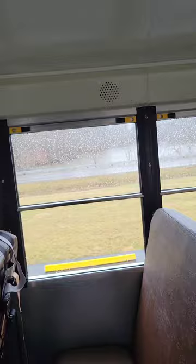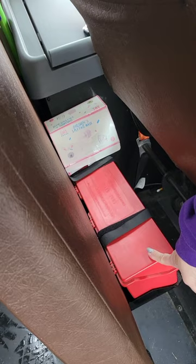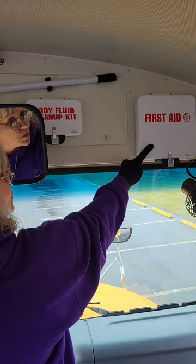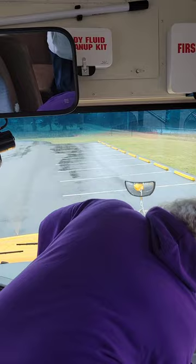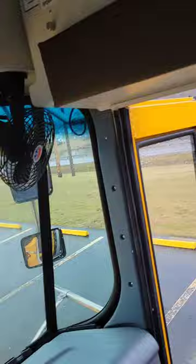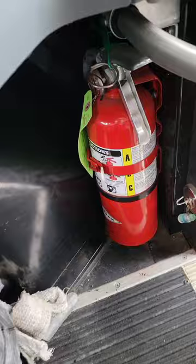My road kit right here behind my driver's seat. It has three reflective triangles. I do not have flares in here because they are not required in Ohio anymore — they are now an option. My body fluid and first aid kits are secured to the bus and fully stocked. I have my spare fuses either in my first aid kit or my road box. My step treads are screwed to the floor with no trip hazards. My five pound ABC rated fire extinguisher is fully charged — needle is in the green, pin is in place. My clear step light lens is not broken or missing, and it is secure to the bus.